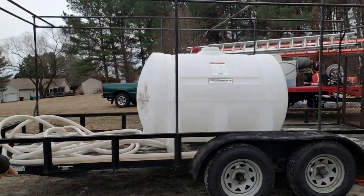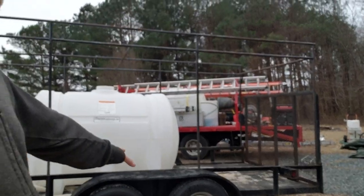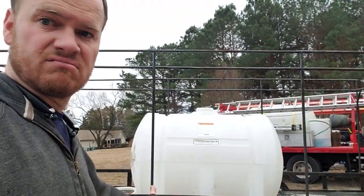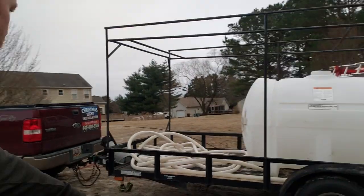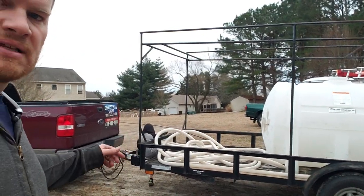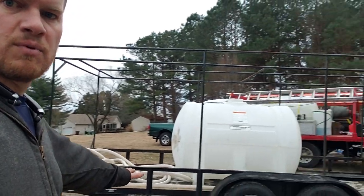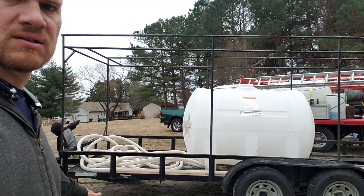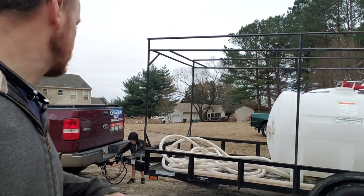You can see I've actually got it a little bit ahead of there, and I could probably scoot it back six inches, maybe a foot. But it's pretty close. The goal is that when this tank is full, for this whole trailer to be level. So that means that some of the hitch is supporting weight and both axles are supporting weight. We wouldn't put it all the way forward, because then it's going to put that hitch really down low, and that's not good for it.